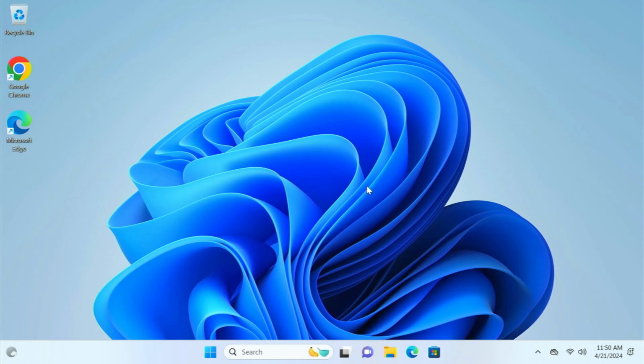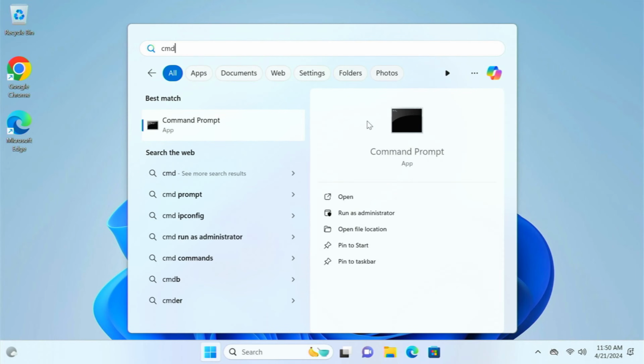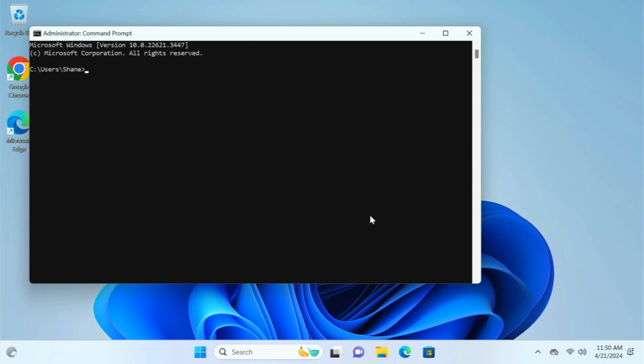So if you bought this thing and you're going to follow along and do this reset with me, what I would tell you to do is first hit your start key and type in CMD, and run command prompt as an administrator, and then paste in this command. I'm going to put it in the description down below. What that's going to do is get you your Windows product key in case you need it in the reinstallation, which you probably will, you will now have that.